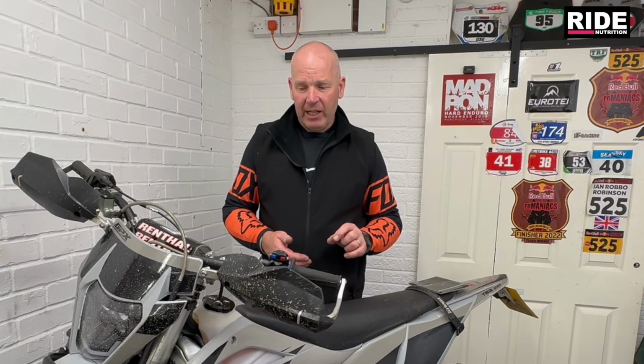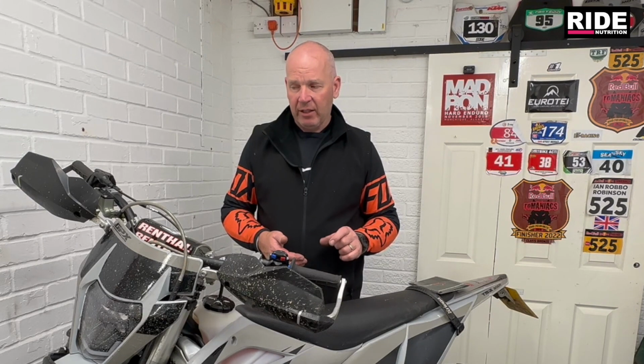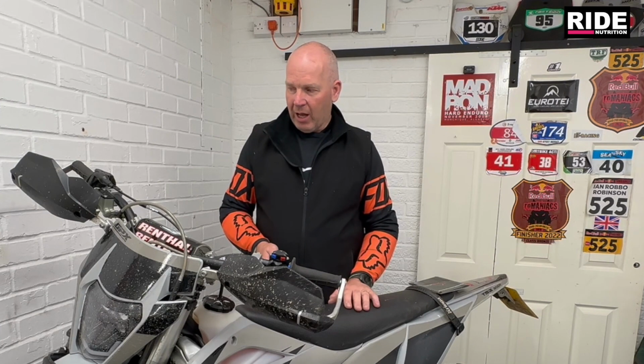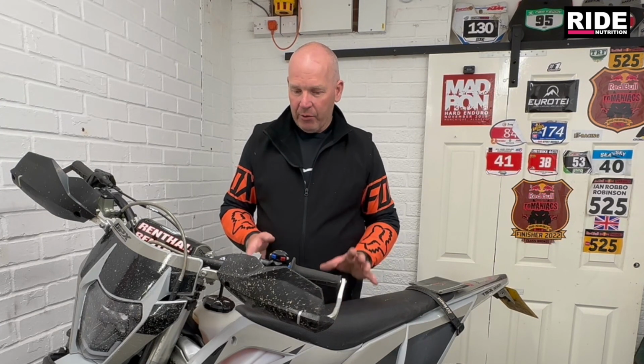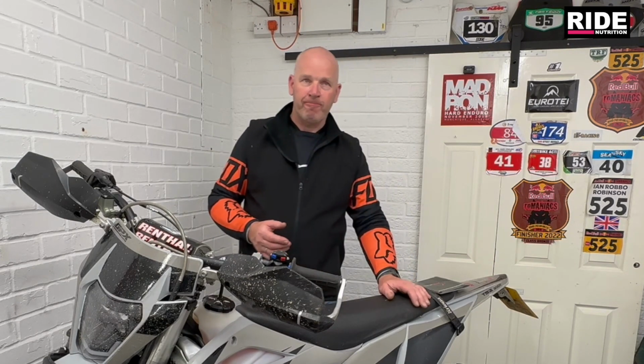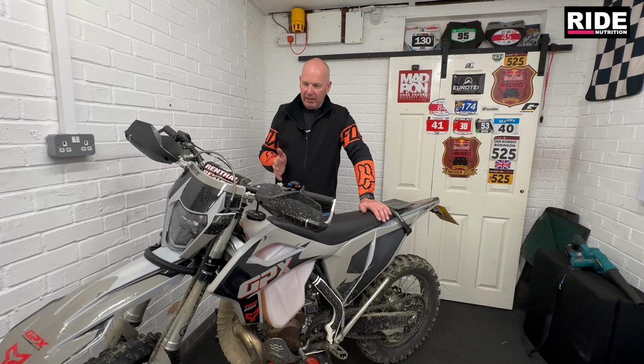I did have to fine tune the fuel assist screw as well, and with the meter rod I think I went 3 more clicks, but where we are at the moment, I'm really happy with this carburetor. Really happy. It doesn't really want to lift off, and the idle settles down really well.